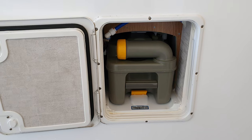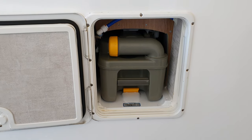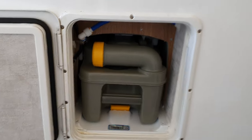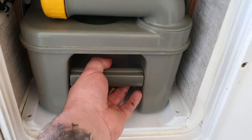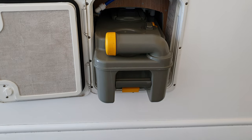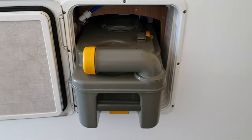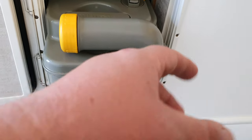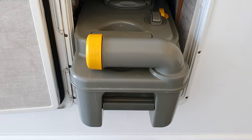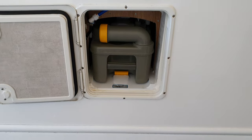For the toilet — when you use it, the waste goes into this cassette. You can see the yellow lever underneath. You need to make sure the lever on the toilet is shut — that's the grey lever under the bowl — then you can lift that up and the cassette slides out from the van. Empty this at your campsite only, not anywhere else. You empty it at the elsan point which is next to the toilet block. This folds out, pulls out, then undo that, empty your toilet, make sure it's fully empty, and then push it back in and shut the door.